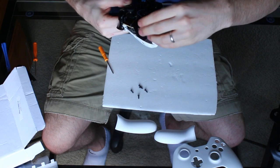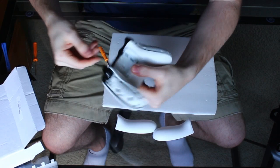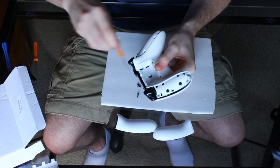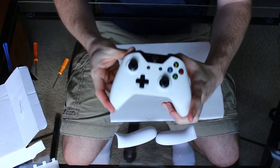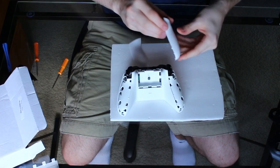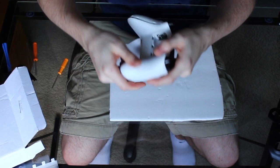Get the motor lining in and the trigger and handle — make sure everything fits in place. You don't want to break or snap anything off. Snap back on the front plate and push everything together — you'll hear it kind of click. Then start with the screw in the battery pack, as that's what holds the front shell to the board of the controller. Just screw everything back together — there are five total. Make sure everything feels right; make sure the triggers are clicking down, because that's going to be the hardest part if you're not used to this. Once everything's good, snap back on the little handles on the side.